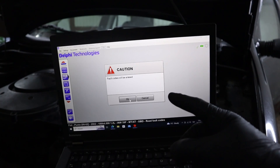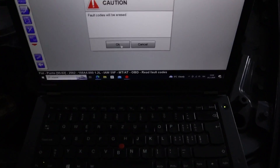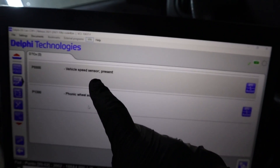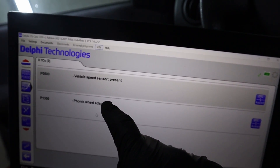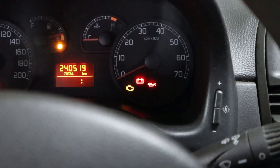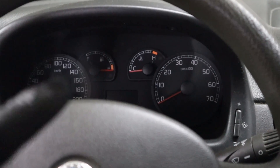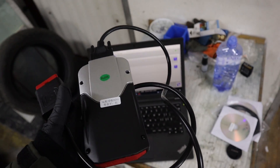And you don't have to pay any subscription, you don't need an internet connection, and it even works wirelessly. We can also erase our faults. But we are left with two codes that cannot be erased — P0500 is already back, so this is a permanent fault, so the check engine light probably won't even go away. It disappeared, but it started flashing because we have an ongoing problem. I am amazed how much value you can get from this cheap scanner.